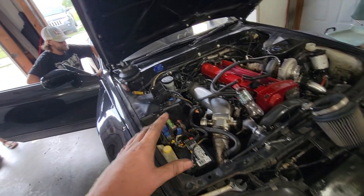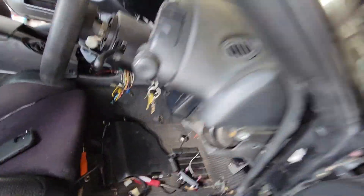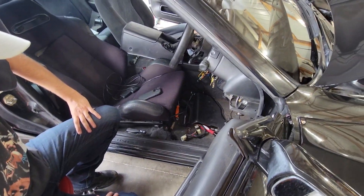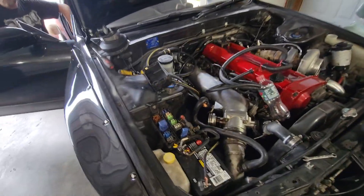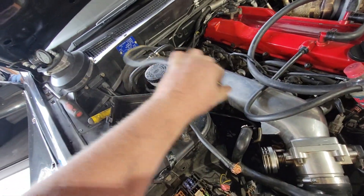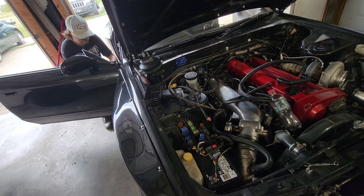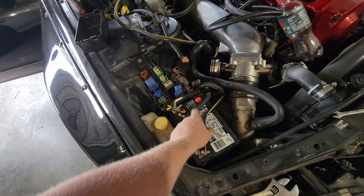There was a certain relay and a certain fuse underneath the driver's side compartment that actually goes with the stock ECU. Having an aftermarket ECU, and just aftermarket things in general, would cause the car to continue running, causing the fuel pump to stay on even with the key off. What I found is that they've got these massive ground wires going to the center console into the switch, and that would basically shut ground off to everything. I've reversed that since.